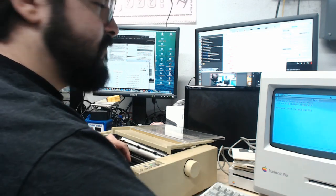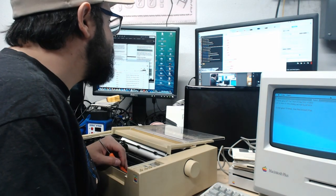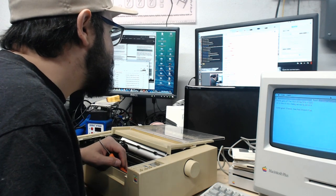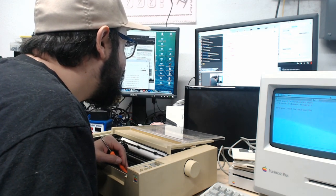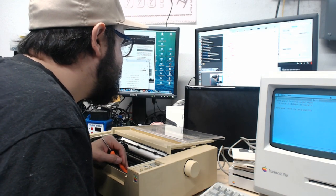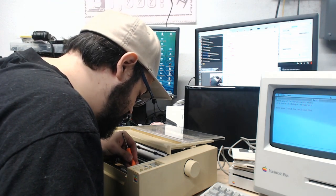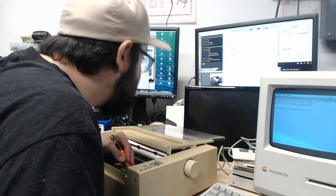All right, cool. Okay, let's try this. Can't screw it up even further than that. Let me turn the printer off first, because maybe you'll get angry at me. I'm using the Macintosh Plus mouse here. That's not helping me out to scroll on this webpage. All right, so, handshake protocol. That is set to the opposite there. Switch 4 is not used. Okay, well, that's fine. Switch 4 is set to open, but all right. So handshake protocol hardware, that is set to off. Baud rate, let's set it to 9600. So both of those should be down. I'm just putting these in the order that it's suggesting here.